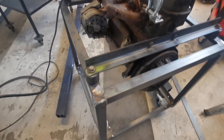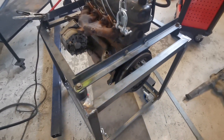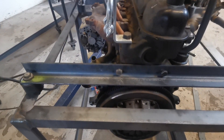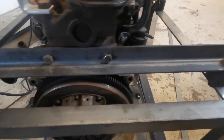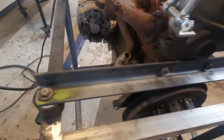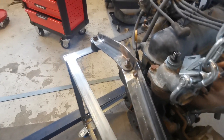I've now got the frame made, got the wheels on, and I've started to put the engine mount on this side. I just took the two bolts that sit there for the gearbox and it's all on rubber mountings. On this side the other mount is a bit more difficult because the thermostat housing is in the way.